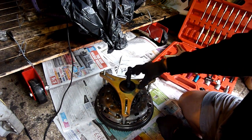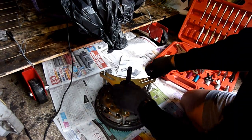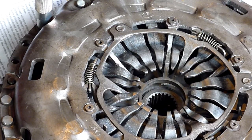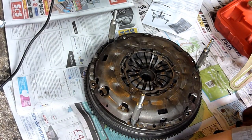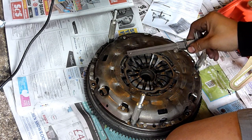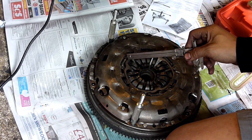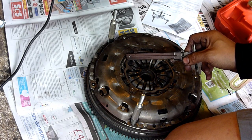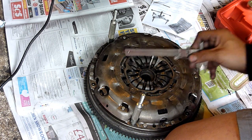I'm really interested in the spring here — I'll try and zoom in on that. These springs here tell you how worn your clutch is when you've taken it off, if you haven't taken the cover off. If it's here where this one is, it's an old clutch. If it's a new clutch, the spring should be compressed and go back to the second notch.